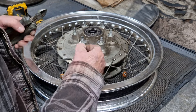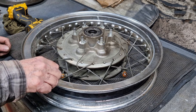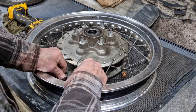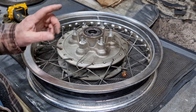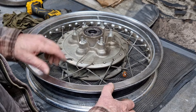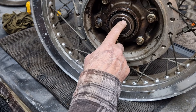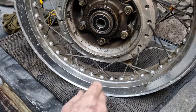This wheel came from the US — the chap I bought the bike from said he couldn't find a decent wheel locally. I do have another couple of wheels but they're in a lot worse condition than these ones, so he sourced this from the US. When I went to check the bearings they're all very good. I'm pretty sure they've been changed because on the hub it says 'Made in the USA,' and the original bearings would have been different. These run nice and smooth with no noticeable play, so I think we've got away with those — which is a good thing.